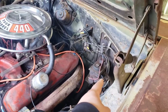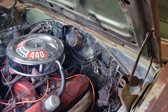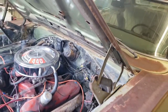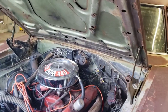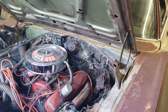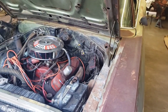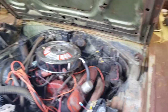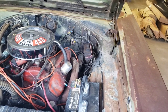The brake master cylinder reservoir was empty. I filled it up, pumped the brakes, and the pedal actually came back — this thing stops amazing. The crazy part: I didn't even bleed the brakes. Everything just settled and worked. I'm going to go through and bleed the brakes before I drive it very far, but I was driving it around a car show and took it up and down the road a few times. It pulls strong, runs good, and drives straight.